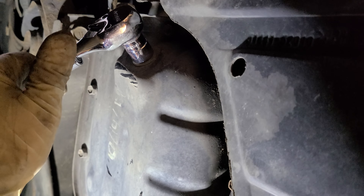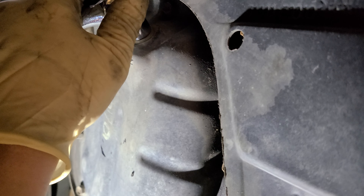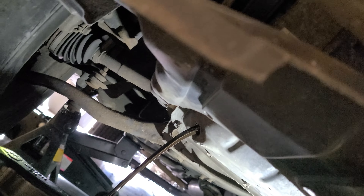It's going tight — you want to go left to loosen it. I recommend you use a six-point socket just to make sure you don't strip that bolt. I have my drain pan at an angle because this pan sits sideways, so let's do the pull and snatch — hopefully we don't spill too much. I think we're at the last thread — snatch. We only got a little bit on the hands, so that's great. We're gonna let that drain and start unscrewing the filter.